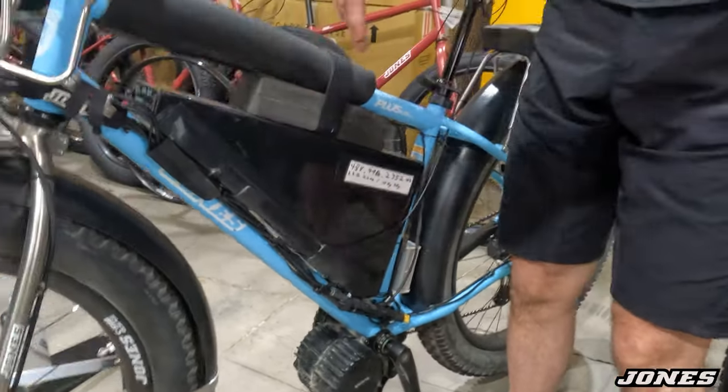After some time of modifying this, I did get it up to around 50 miles an hour, but I couldn't go much faster. Then I put a little windscreen in the front and I went a lot faster, much easier. Now I have a pretty nice wraparound in the front. About two weeks ago, I jumped on the freeway and maxed out at 72 miles an hour. Coming down like this in the tuck position, it's nice and very comfortable behind this thing.